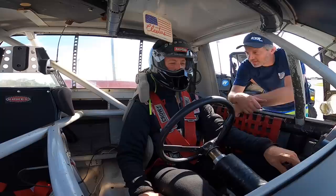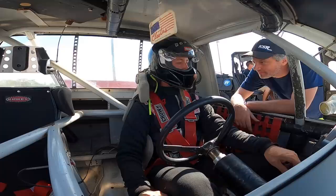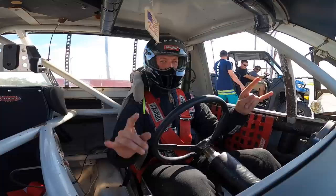So do I need the fan switch on or will it all come on? No, it's all automatic. Like the fan and water pump come on as soon as the engine runs. Fan one comes on at 180, fan two comes on at 195. I'll cruise around and get some temp up while you guys go over there.